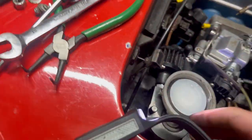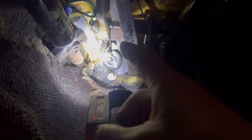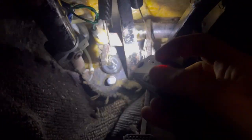So now I've got to go back in and we've got to release the clevis pin. As you can see, the bottom one's pretty easy, the top one you've got to thread through, but having an electric tool makes it easier because every time you do that with a ratchet, you risk knocking the spanner off the other side. But yeah, that was really nice. Nice job. So got to take the clevis pin off and then remove the master cylinder, swap the rods over, put it back in, which is slightly harder than taking it off. So we'll see how we get on.